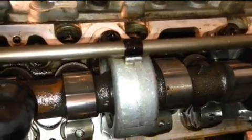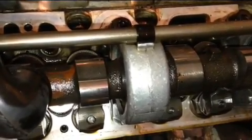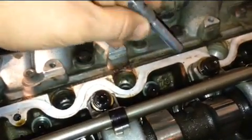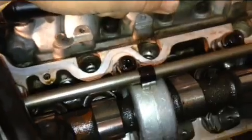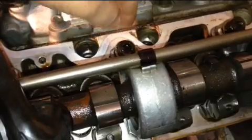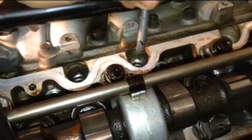Next step: I've already ordered the new fittings for the injectors. As soon as I get them, I'm gonna assemble them one at a time and check compression on the motor. I need to put new gaskets on the valve covers, but after I clean everything nicely and put the injectors back in, I'm gonna check compression on each cylinder and make sure I have good compression.